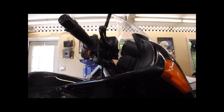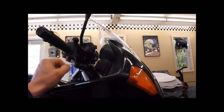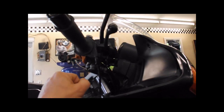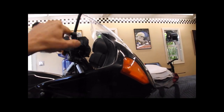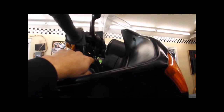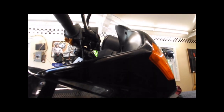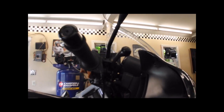Could be a defective master. The bike fell over on its side, and the customer stated grass was stuffed in here. It's possible that it's just a pivot, so I'm going to address that first and see how that pivot bolt is. Sometimes if you loosen them just slightly, you'll regain full function of the brake lever.